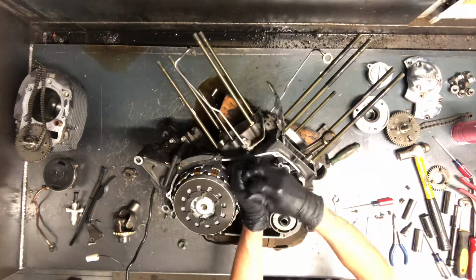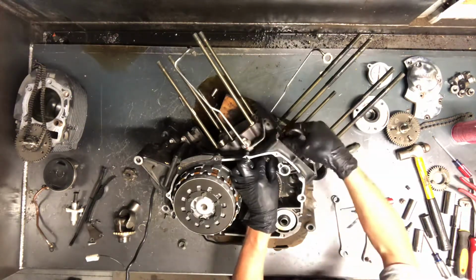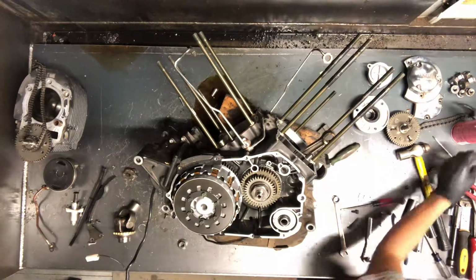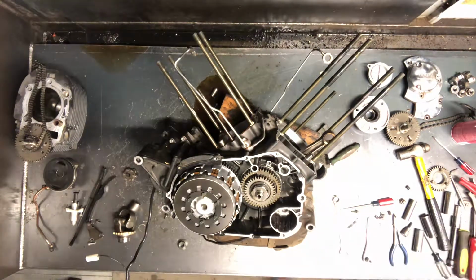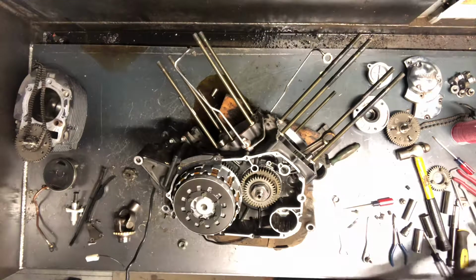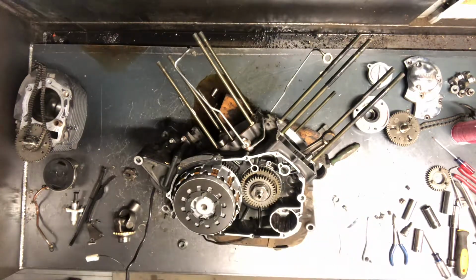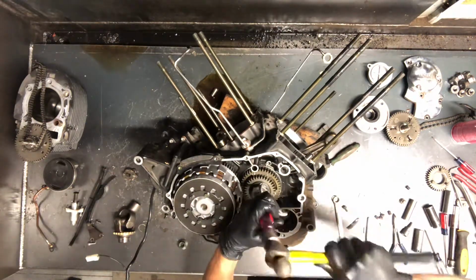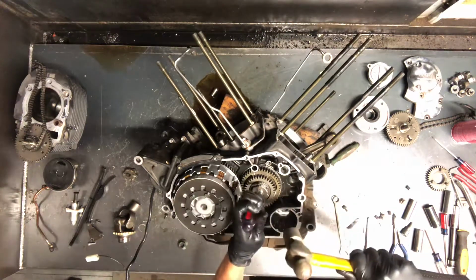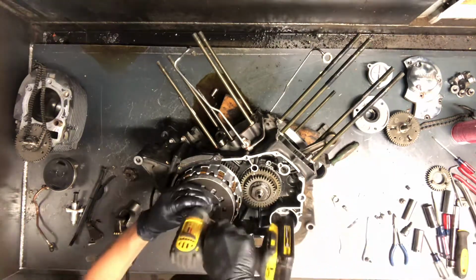These bikes can go a lot of miles. One of the first things you'll replace is the clutch plates. Front guide's off there. Oil filter just pops out. This gear here sits on that crank. It's got a holder that holds that nut from spinning off. All right, now we'll go ahead and remove that clutch. So 10 millimeter.